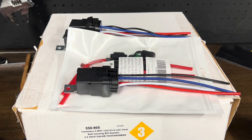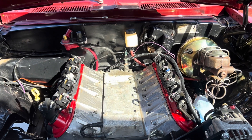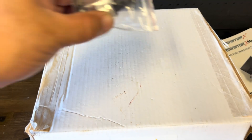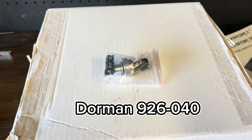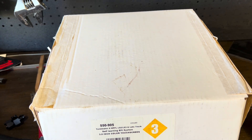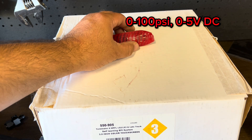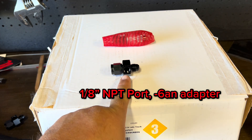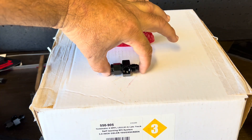You'll need fuses to protect those relays. If you plan to run a fuel pump over 15 amps, you need another relay and fuse for that. If your oil pressure sensor doesn't look like the one shown, it won't work with the Holley Terminator X — pick up a new one; there's a part number on screen. The Terminator X reads fuel pressure, so you need a 0-to-100 PSI sensor with a 1/8 MPT adapter to hook up to your fuel system — this sensor is from Dollar Motorsports.